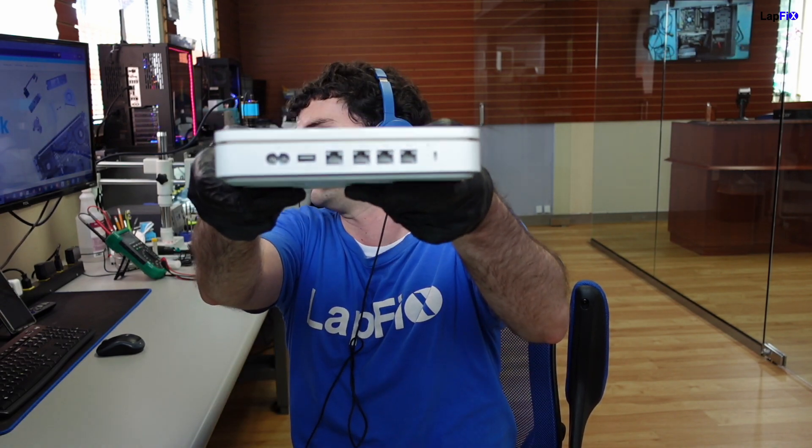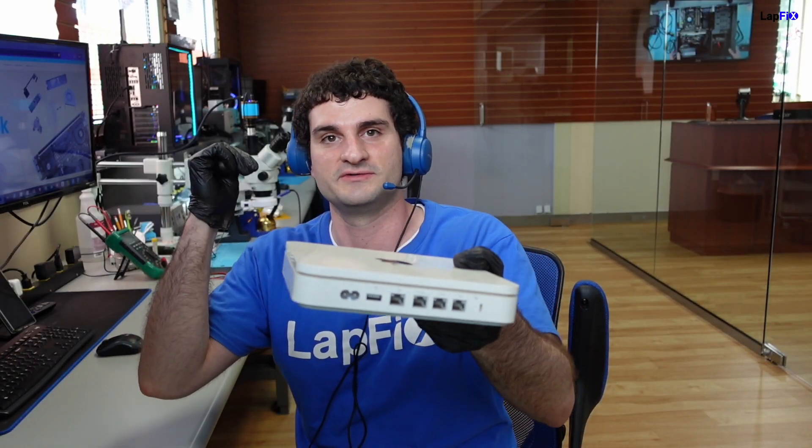So it's like a NAS drive that you use. You configure it through Airport Utility, which a lot of them still have - even the newer OSes still have Airport Utility. You can access it through a network and connect to your network, and it's all nice. But sometimes they have trouble and sometimes you can't access them. You can try resetting the network settings. There's usually a username for an admin and a password. You can access it that way through the Airport Utility tool. You can also connect this directly through an ethernet connection - that's why they have all those nice connections on the back.